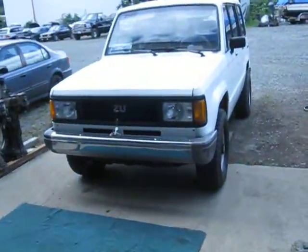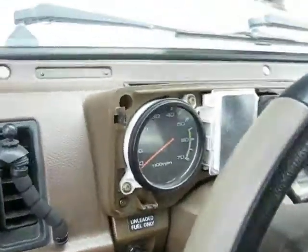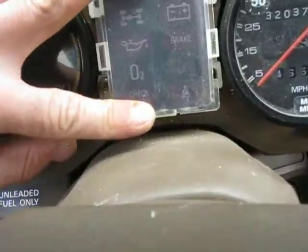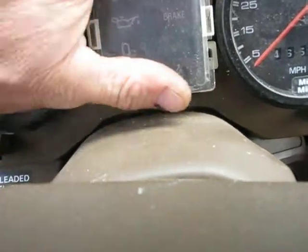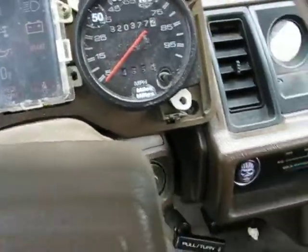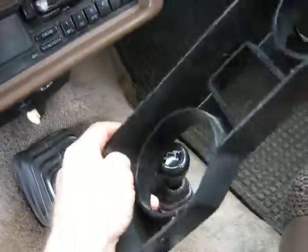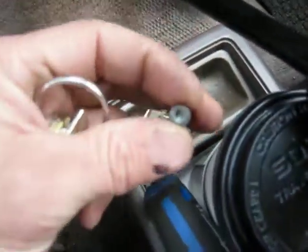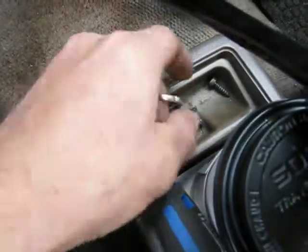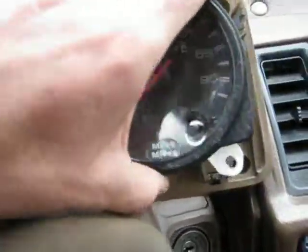So let's have a look at the old '91. Alright, this is Goldie. Goldie got an engine swap recently, but we didn't reset the gauge. The O2 light was always on and it needed to be reset. So when you pull this gauge out, you just got to get your gauge ABS surround off. You've got these four little hex bolts here — they're not so bad. Get those out. There are two Phillips head screws holding in this gauge.